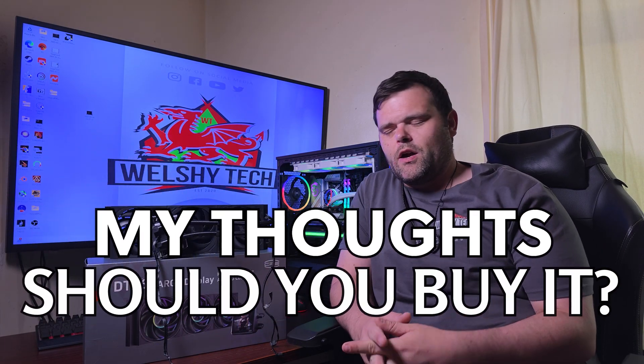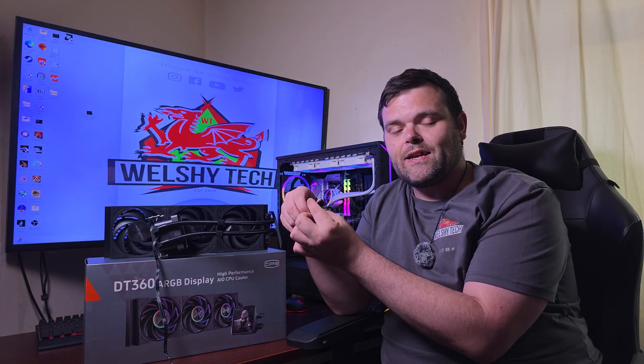So what do I think? I like this AIO - I like the overall fit and finish, the design, and the aesthetics. The fans have nice RGB illumination with the ring inside, not too in-your-face. I love that the connectors are standard ARGB and PWM. Fans come pre-installed and pre-cable managed, which is fantastic. The pump is four-pin PWM - considering it's 2025, not all brands do this, which really bugs me. Four-pin PWM for pumps should be the standard by now.